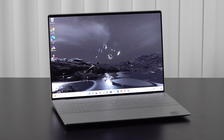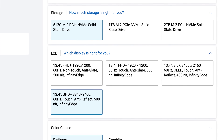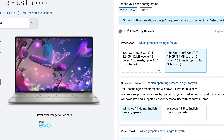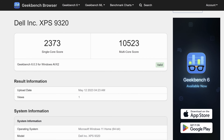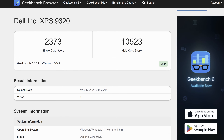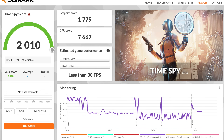You're going to do better in terms of battery life if you go with the IPS option. There is also a UHD Plus or 4K Plus option, but I don't have that on hand to comment on battery life. The only refresh here is the processor — the 13th gen Core i7-1360P, a 28-watt CPU with 12 cores: eight efficient cores and four performance cores. From Geekbench 6 single-core and multi-core results, there's definitely good performance — about a 10% increase over last year. It runs the same Intel Iris Xe graphics, with no big year-over-year difference; the Xe graphics are getting a bit long in the tooth.